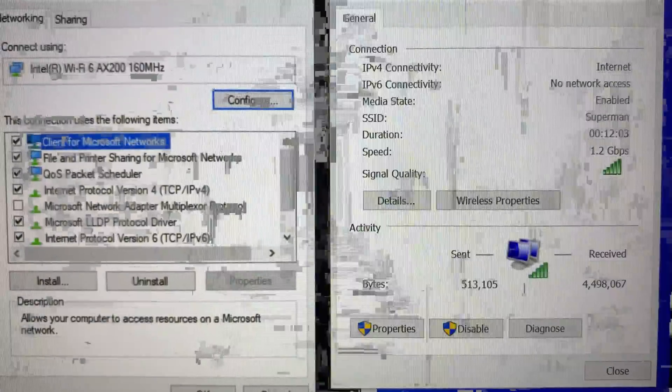I have a 1-gig Verizon Fios connection. For the first test, the MacBook Pro is connected via ethernet and using Fast.com we are getting close to 1 gig internet speed, confirming the router can handle 1 gig internet — a surprising and good start. For the first Wi-Fi speed test, the laptop with the Wi-Fi 6 card is placed right next to the router, connected to the 5 GHz Wi-Fi 6 band at up to 1.2 Gbps. Using Fast.com we're getting 560 Mbps download and 460 Mbps upload, and with iPerf 3 five-stream test we're getting 719 Mbps bandwidth.